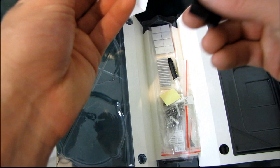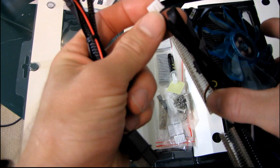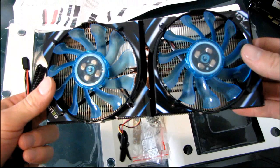They've included an adapter — the Icy Vision comes with one of these little proprietary video card fan connectors, but you can adapt it to either a three-pin fan connector or a Molex connector. So even though it has two fans, you only have to plug it in with one header, which is pretty handy. They also include some GC2 thermal compound.